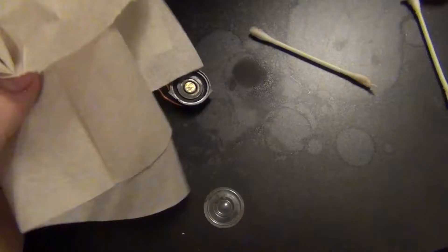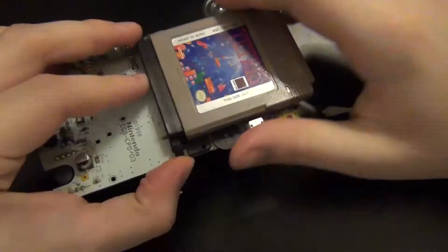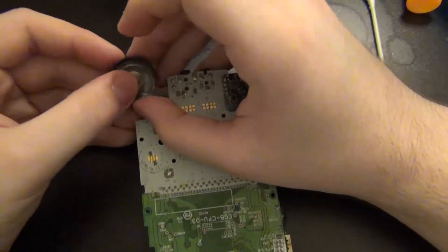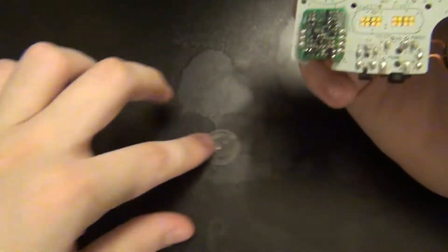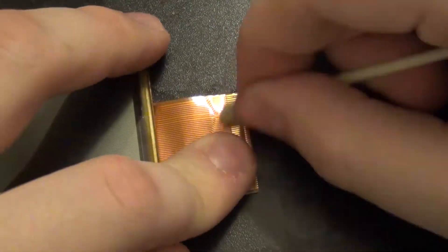I started to clean the speaker. This little plastic bit right here comes off. Unfortunately, I was unable to keep the little plastic bit of the speaker itself, so I had to discard it. And of course the speaker did not work. I'm also cleaning out the cartridge pins. I tried to get the little plastic bit of the speaker to stay back on, but no matter what I do, it won't stay on — so I screwed the pooch on that one. I tried to clean the pins on the ribbon cable, but the screen unfortunately was not able to have anything removed from it. However, thankfully the screen does work as intended, so I don't have to worry about it, though I'll keep an eye on it to see if anything changes.